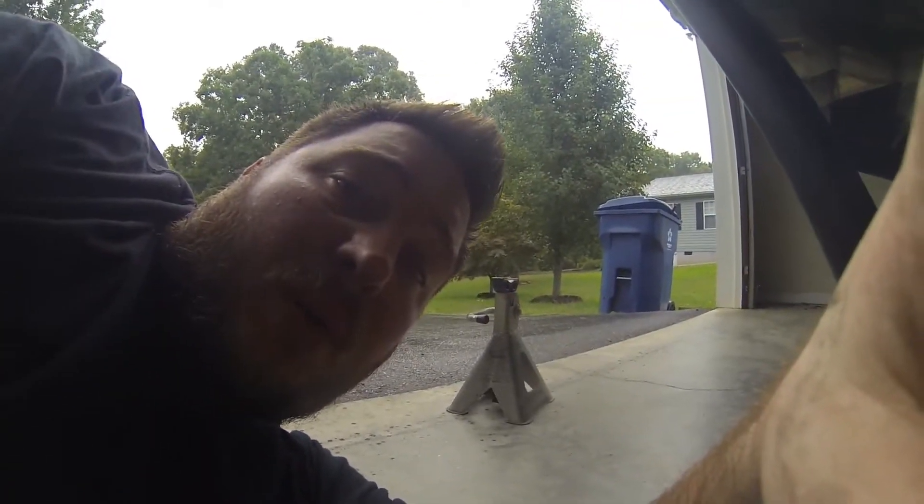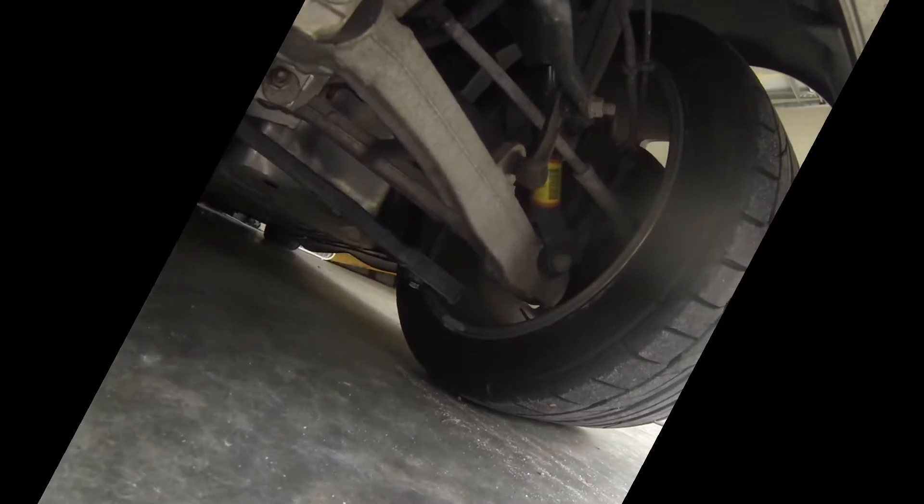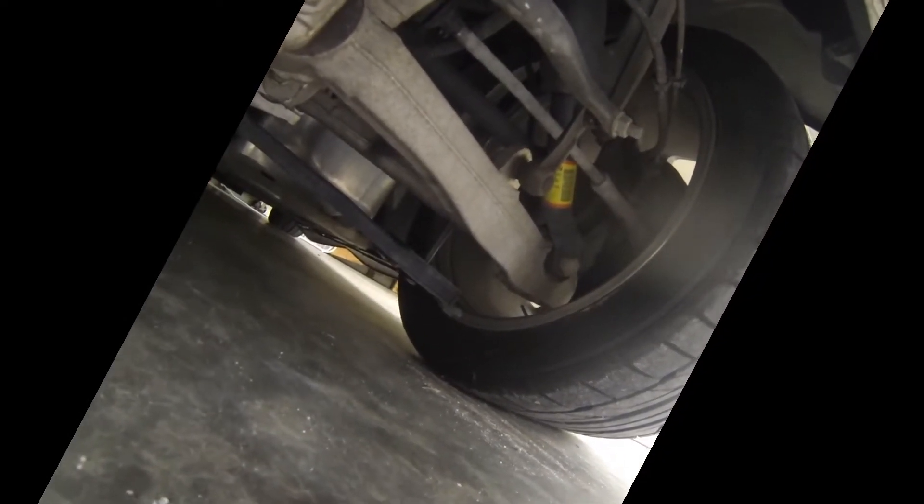The back is pretty simple — the front is what's a nightmare, so we'll see what happens with that. All right guys, I'm going to show you what happens whenever I lower the car onto the bolts. So the back is done. It looks amazing — it's probably a little bit too low. I'm going to have to drive around, see if it scrubs, and if it does, we'll just lift it up and spin the bolts and bring it up three-quarters of an inch or whatever it needs.